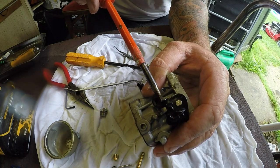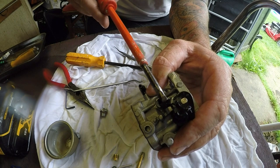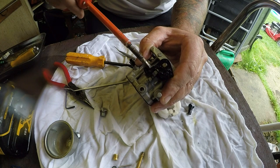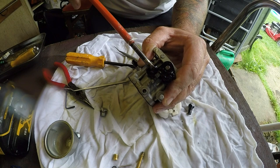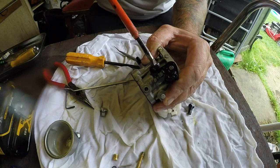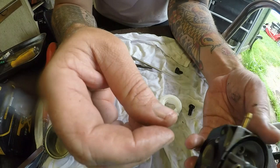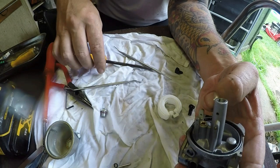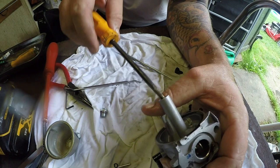That's tight, so we're going to go - that's tight there, that's six, five - lost count - that's a quarter, one, two, three, four, five, six - that'll do it. To be fair, I'm not seeing a great deal wrong with this lawnmower apart from the fact that that bottom seal had gone. I'm hoping that the o-ring replacement will be enough to get it to run. Everything else seems to be exactly what it needs to be.